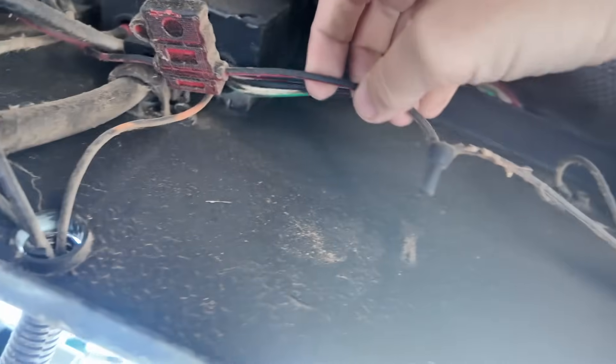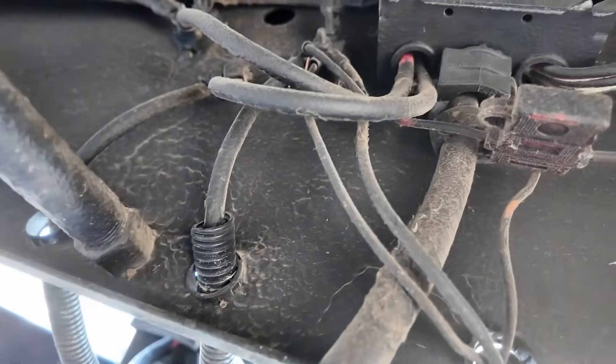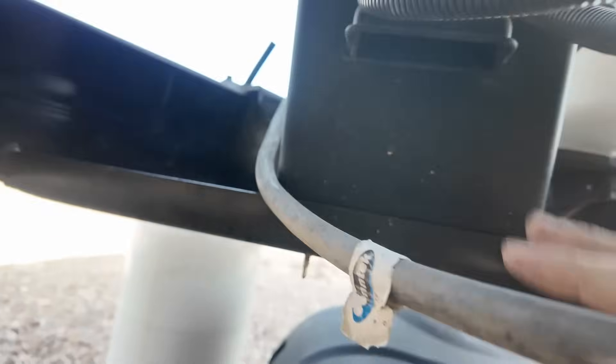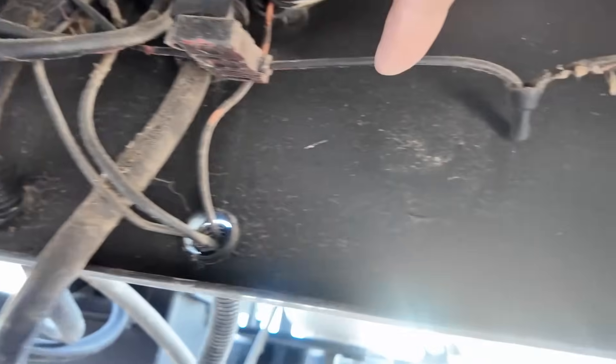You can see the wire moving right there. We move over to that side: one wire goes up and connects to the chassis for a ground, and another wire goes over here to a fuse, and then from the fuse it goes to this bus bar right here. There is a big fat wire that comes down through the chassis and out to the battery - you can see that is red right there, which is your positive wire on the battery. Basically all that port does is run from here to this bus bar and then over to that connector on the outside. It is just an extension cable that plugs directly into the battery.